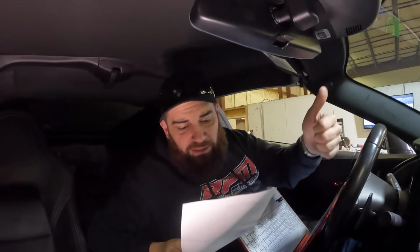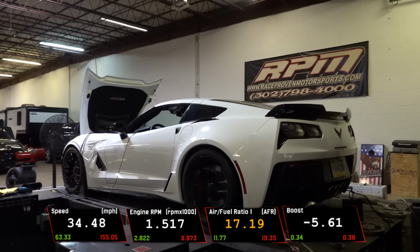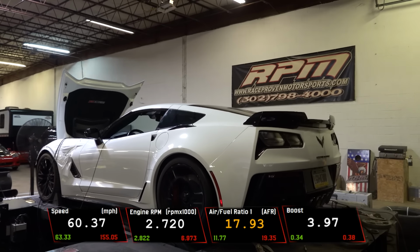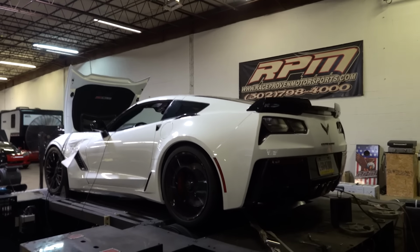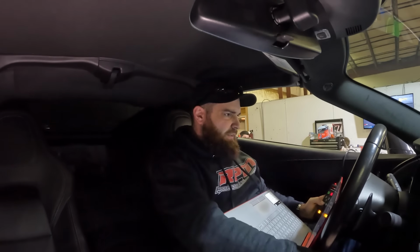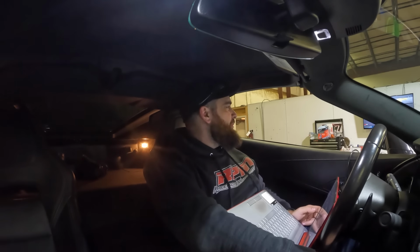Z07Z, got our full stage two package. So 2-inch Merrick Racing headers, plugs, and Rotofab big gulp air intake. It made 588 baseline, manual car. So let's see what we got. Little lean. Figured it was because the comp file I have wasn't for a big gulp, and this has a big gulp on it.